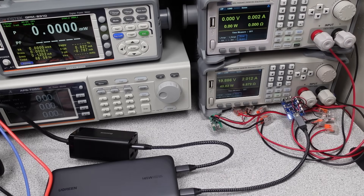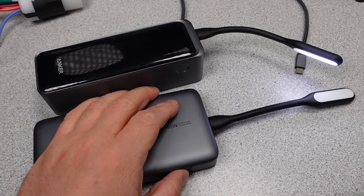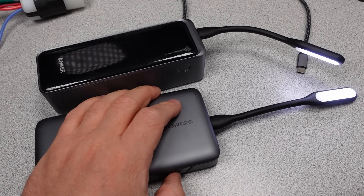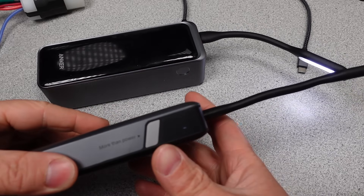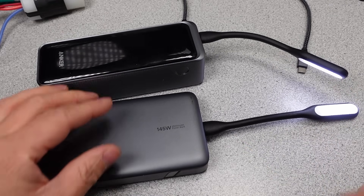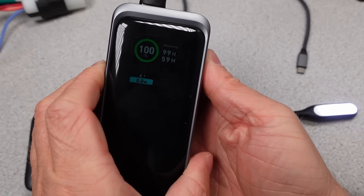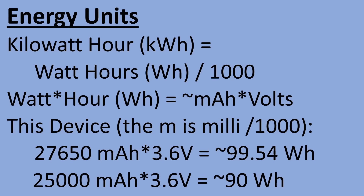Anker claims to not have the UPS feature and indeed does not — it turns off right away. Both of these power banks have a low power mode: with a double click, they turn on the USB-A port for several hours to charge low power devices, though I'm still having trouble getting it to turn off on the Anker. These power banks are within the 100-watt-hour requirement for carry-on air travel. They're a little heavy, but can still be carry-on power banks. The Anker is about as close as you can get to the limit at 99.54 watt hours — and remember, watt hours determine if it can fly, not watts.